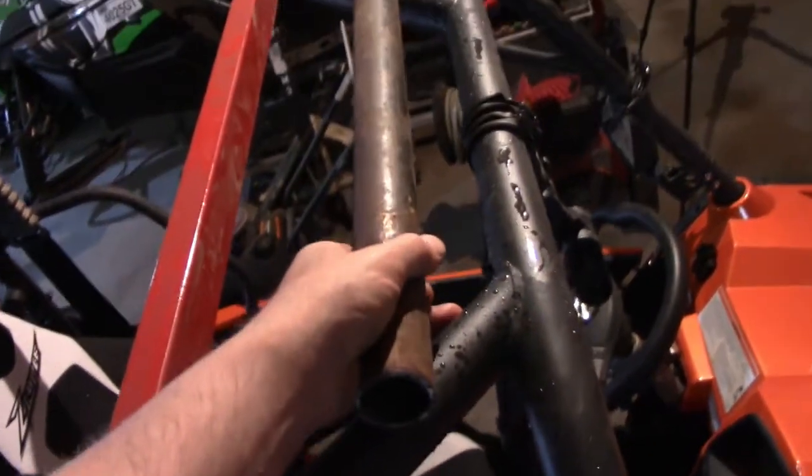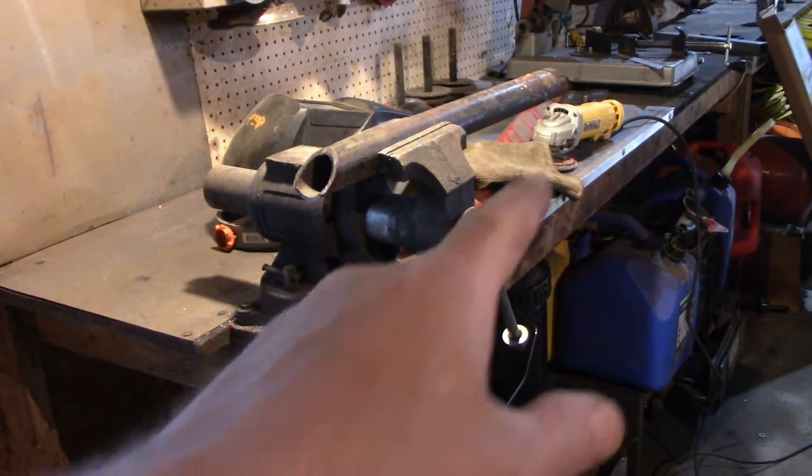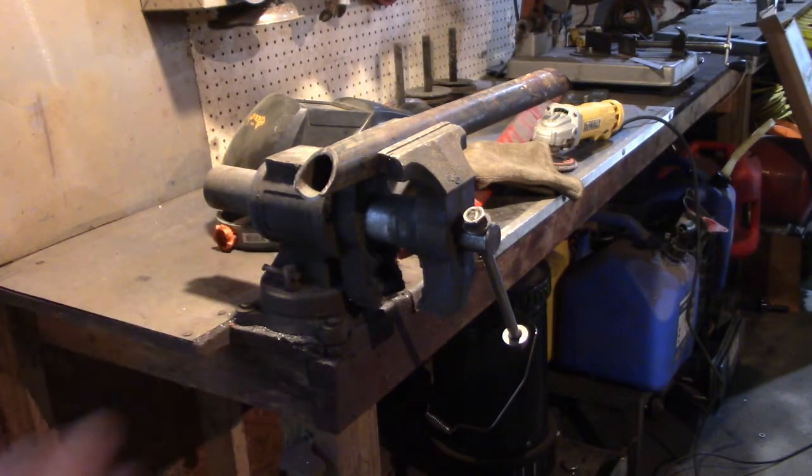I think I'm putting a piece of pipe in. I just chopped a 45-degree off both ends and I'm going to use the grinding wheel to kind of grind in there, cope it out, and just keep going back and forth getting somewhat of a good fit because I'm going to weld this on there. It doesn't even have to be perfect, but we'll get it close enough.